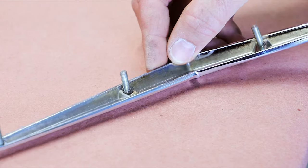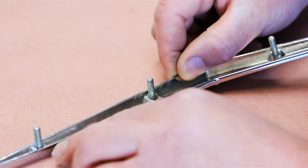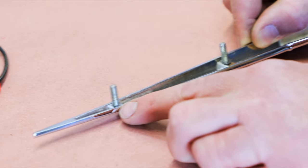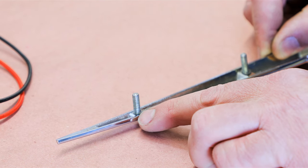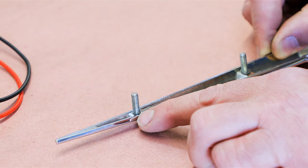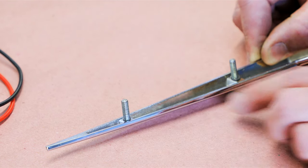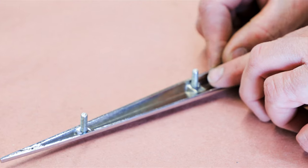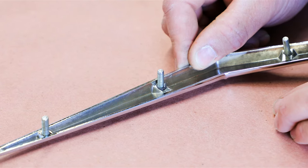Okay, it looks pretty straight, a little squeezed out. It's not in a place to cause problems. If it was one like here and it squeezed out, it would cause problems. But you can come back later after it hardens, get in there with a needle file or even a nail file or something and clean it up. This one here's got a little bit more because we did have the strip out, and it's okay. A little around the edge gives it some reinforcement.